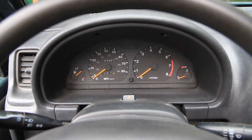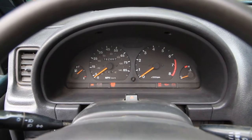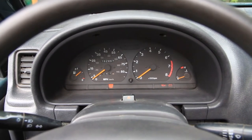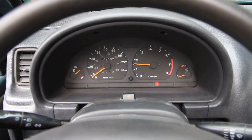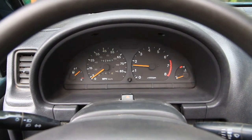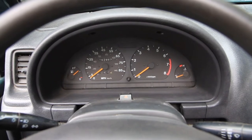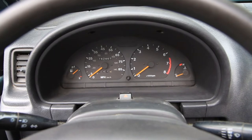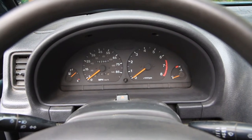The only surprise I've had with the Suzuki is recurring check engine lights and OBD2 codes that have prevented me from passing emissions. I ended up buying a jerry-rigged truck where the bulb for the check engine light had been removed to hide the fact that it was always on. In the next two videos I'm going to show how I resolved five separate OBD codes to get this truck running right, starting with the most obvious — the most straightforward codes — and saving the best for last: P0171 and P0443.